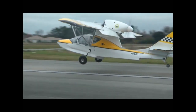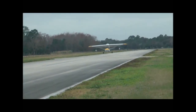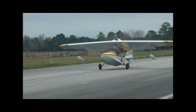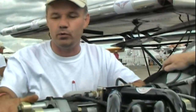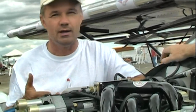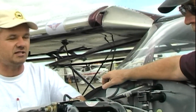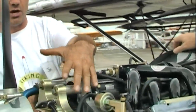When you think of a hot engine, you think of something that revs in the 5,000–5,500 range. How do you get that RPM down to use it? You'll be surprised at how similar this engine is to Rotax — if you look at the RPM, the horsepower, the weight, the power-to-weight, it's very similar. We have a slightly different gearbox ratio up front. We have the same takeoff RPM of 5,800 and cruise at about the same RPM, 52 to 54. Pilots used to Rotax will be familiar with the RPMs right away. There's a gearbox up front with a flexible coupler between the gearbox and the engine.